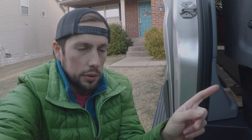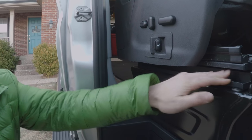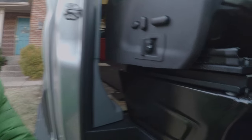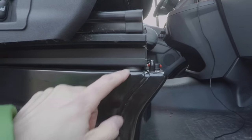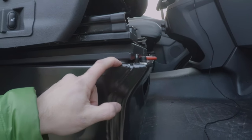As you saw on ours, we had to do three customizations. First, we had to drill two new holes in the swivel to actually align to the factory holes on the seat base. Second, we had to trim the side of the seat trim in order to clear the swivel whenever it was turning. The third was adding a couple of washers as shims on the front two mounting holes of the seat base.